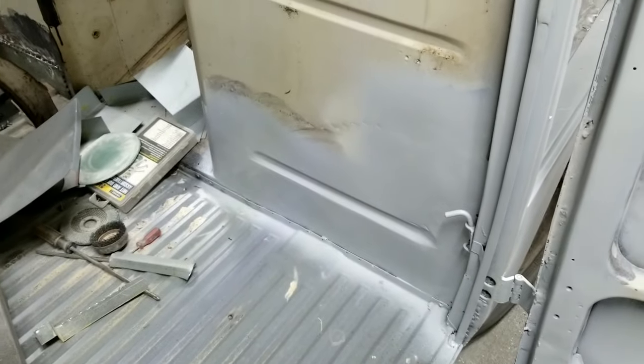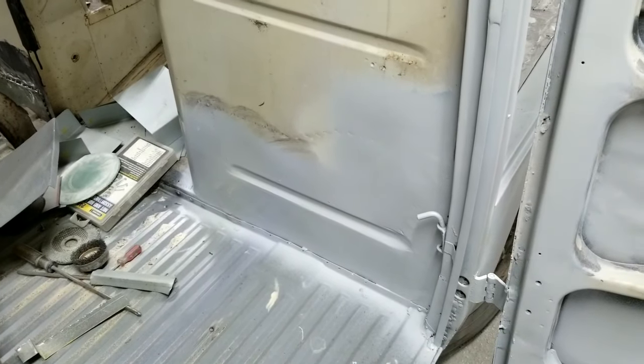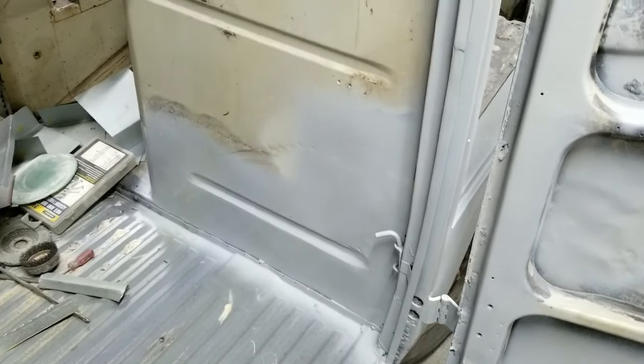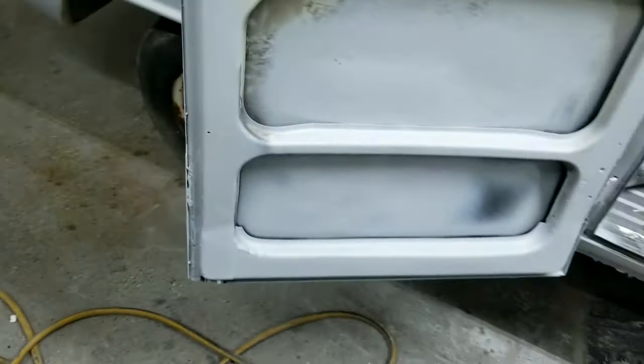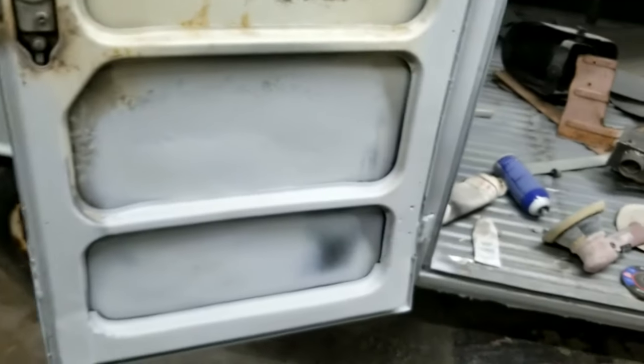Look inside here. That's just a crash coat of filler on there and I bombed it with the sander for a couple minutes. Not really trying to make that look super cherry. Again, this is before blocking. So after you block it, then you're going to do a lot more to it with your block. That's where your real work is on the blocking.